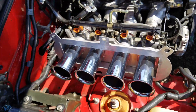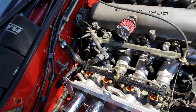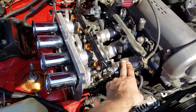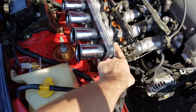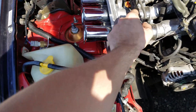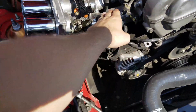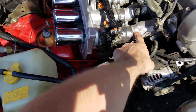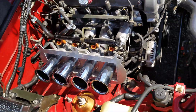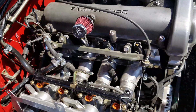That way you've got a stronger vacuum signal, because usually ITBs tend to pulse with their vacuum and make it a lot harder to tune. By having all four of them routed together it gives you a little bit stronger of a signal. I actually got super lucky and acquired the cut intake manifold, silicone coupler, the little adapter, the P600 base plate, and the Weber 48 IDA velocity stacks — the throttle bodies, the velocity stacks, the base plate, the cut TIG-welded intake manifold — all for 200 bucks, which was a complete score. But it'd be super easy to replicate this yourself just by cutting a 1.6 Miata intake manifold, welding some pipes on at an angle, and piecing it all together.